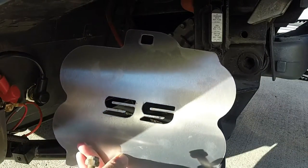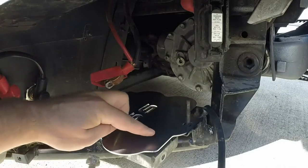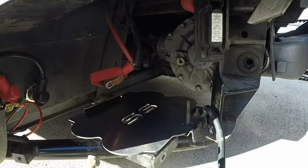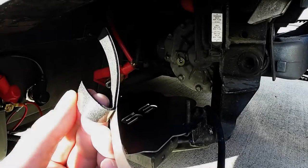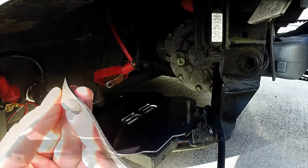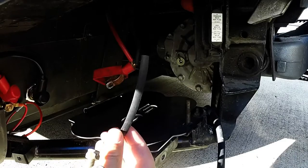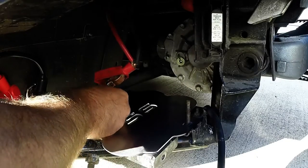Remove the protective film and install the new battery tray. Be sure this curve on the tray is facing you so that you know the battery tray wasn't installed upside down. Next, we're going to install the adhesive rubber foam along this edge. Peel the backing off the foam and place it on the edge, then install your rubber trim over the adhesive foam.